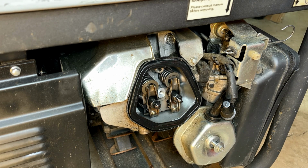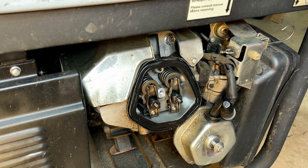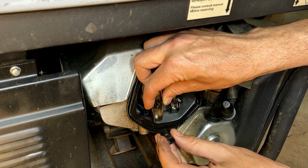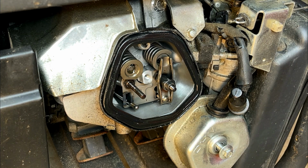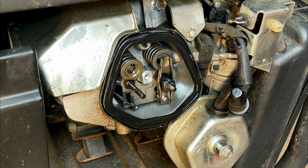Wow, that was very loose. I guess the good news is the valve retainer is still holding on to that valve. What I'm wondering though is, should there be a rotator cap on there? I'm not sure. Anyway, this is really tight, the intake, and I'm not sure where I am on the stroke. So I'm going to crack that loose too. I mean, if this is overly tight, that's going to create drag on the cam and could also cause the issue we're seeing.